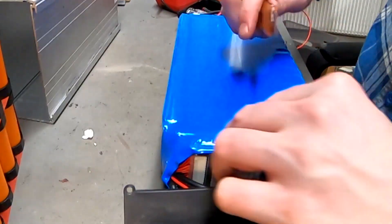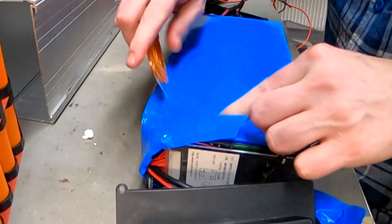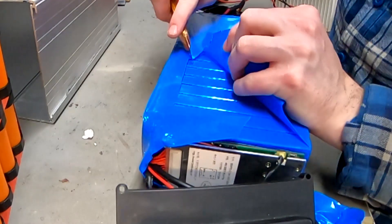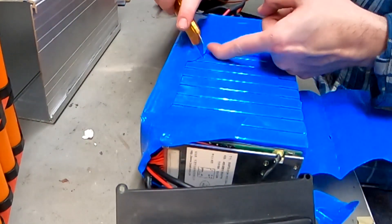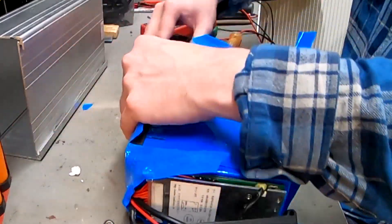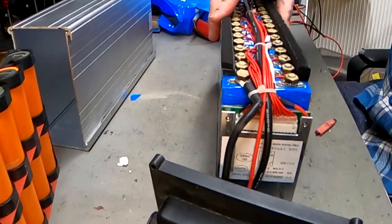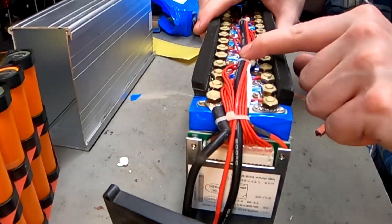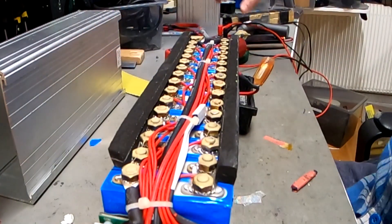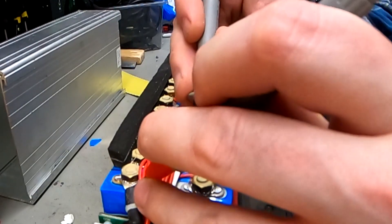Are they using prismatic blocks? Yes, they're using prismatic blocks. In one of the other Golden Motor videos we did, they used these blocks and one of the blocks was dead but it still took a charge. But this is not the same. This must be a 16s LiFePO4. They even have a temp sensor up here and lock nuts on the screws. Let's check the full voltage: 55V. So this one should be fully charged and every cell should be around 3.3V.